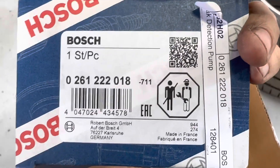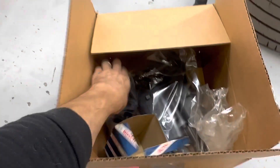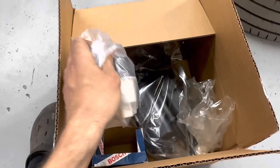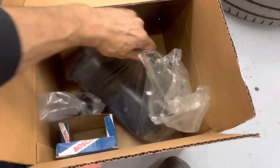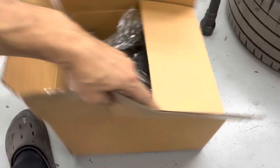On a DMTL pump, here's the part number for the Z4M — it's in a different location, I'll show you in a second. This is the updated part number. Go ahead and replace your charcoal canister at the same time since you're in there already. The part number for the charcoal canister is right here.